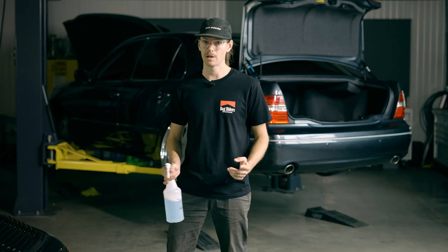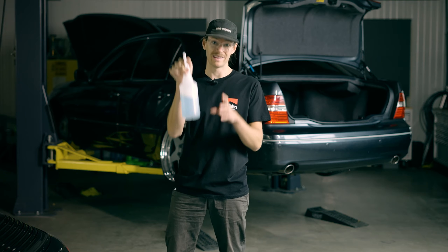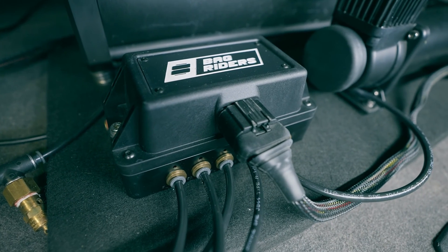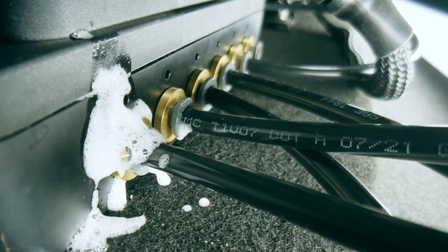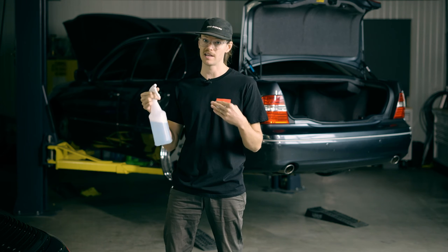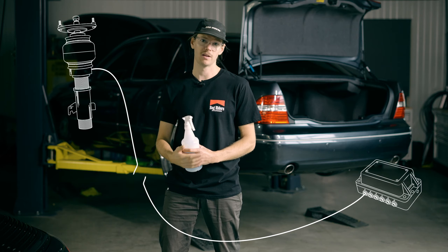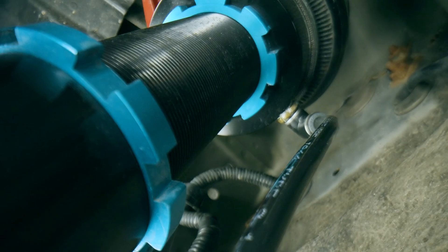What about a suspension leak? Why are you going out to your car in the morning and finding it all lopsided? Again with the same soapy water and the same principle of eliminating what it's not, we're going to find that leak. The first place to look is in the trunk — part of the suspension side of the system is in the trunk, starting at the manifold. If you've got your four ports going out to your suspension, test those first. Then look at the exact corner of the car that is leaking, because the only places air could be coming out of are the fittings going into that bag, or the airline that runs between the management and that bag, which could get pinched by a moving component or burned by a hot exhaust component.